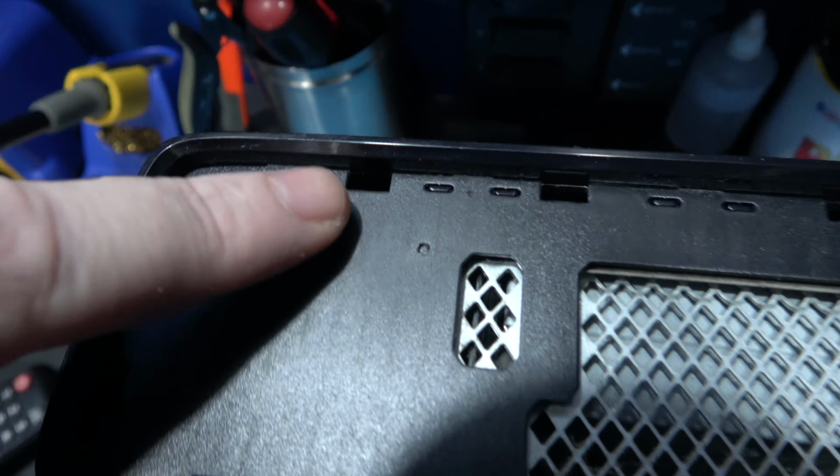And there we go, it got my CPU key. We know it's worked because it's decrypted everything. So that's winner winner. What I need to do now is make sure I'm still on glitched, yes. And I need to make my glitched image build. And there we go. What I need to do now is hook up the JR programmer and flash the NAND. So I'll get everything set up and we'll crack on with it.